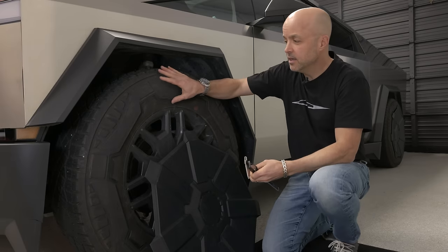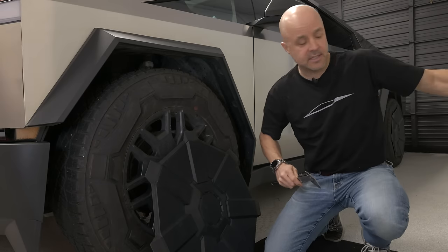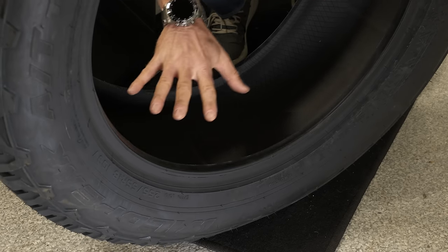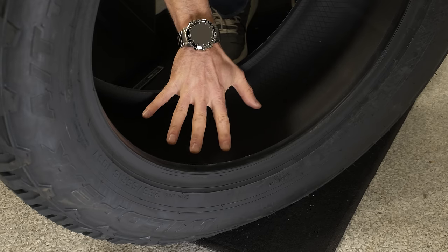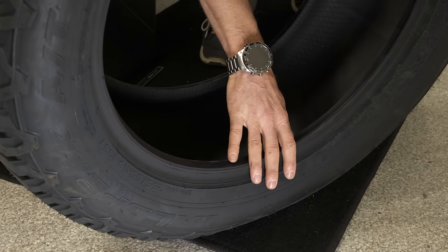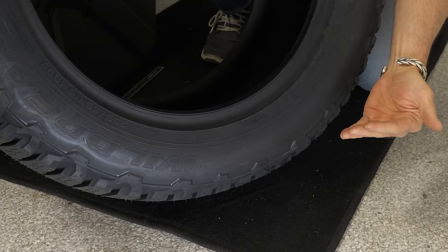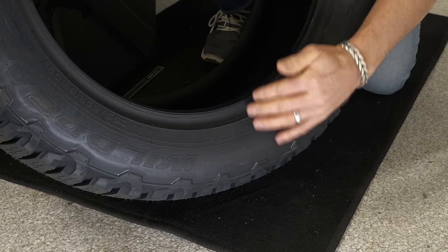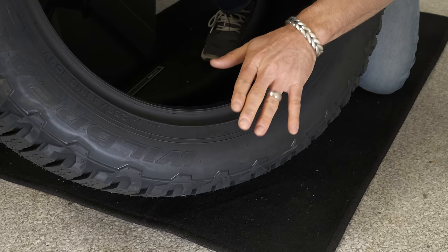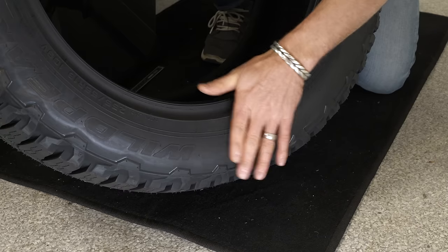What does this mean for the tire? The good news is the sidewall of the tire is really not the most critical part. It doesn't hold the air in the tire. If we look at a tire from the inside, there's a layer of rubber called the inner liner — this is a butyl rubber, and this is what holds air in the tire. That's not something you can mess with. Then in between the inner liner and the sidewall, we have cords, which are a very important part of the tire. The sidewall's primary purpose is to protect those cords. So if you have some scuffing or scratches on the sidewall — even if you hit a curb — if it's superficial and you've only rubbed off some outer rubber, that may be okay. But if you can see the cords, that's a problem and the tire is scrap. If you can't see the cords, it's probably okay — but get it checked at a tire shop. The outer sidewall is really only there to protect the cords and carry the markings on the tire.